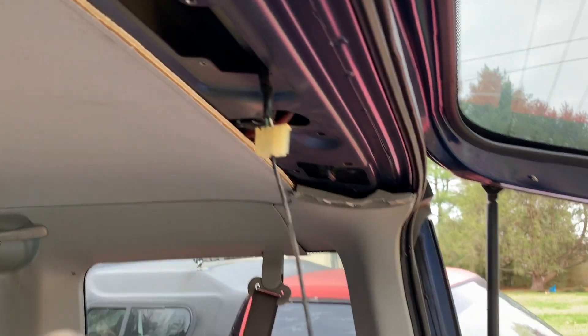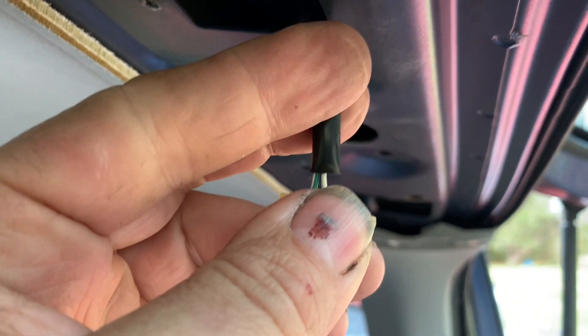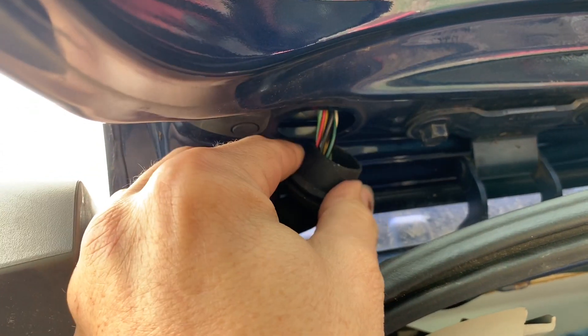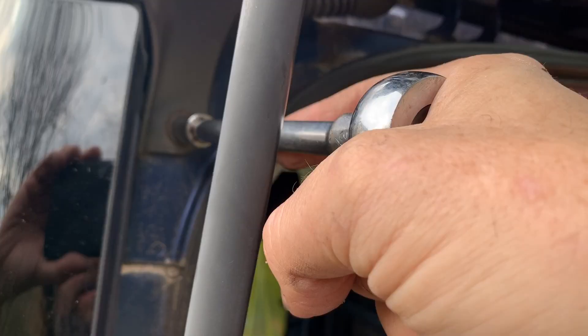It's not going to be too tricky — we only need to snake one wire, because the other wire is going to be a ground and we're going to ground it to the back of the wiper motor. The wire that we're going to be pulling is this white wire, so we're going to tap into that and pull it through this frame and through this piece right here. This just pulls out — see all those wires? That's everything going into the hatch: the wiper motor, the sensor to tell you the tailgate's open, the little light for the license plate. We're going to take the snake and snake one extra wire through there.